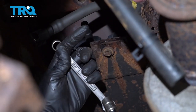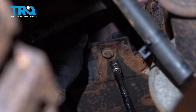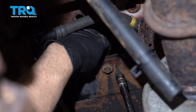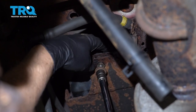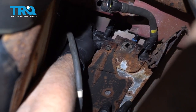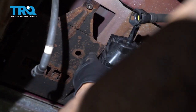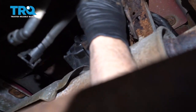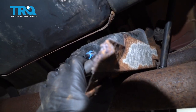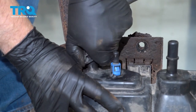Now I'm gonna take a 13-millimeter wrench and a 13-millimeter socket. There's a nut on the top and a bolt down here. Sometimes there's a bolt going from the top down, so you might need a ratchet wrench to take that off. But this one's like this, and this whole thing is gonna slide out a little bit, then sideways over the muffler, and then tip it down. Just slide it out like that so we can take this hose off right here — we'll transfer it over to the new one.